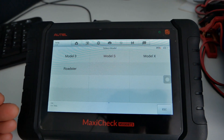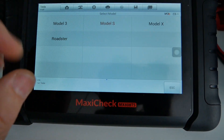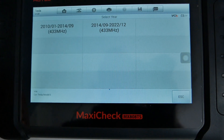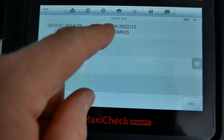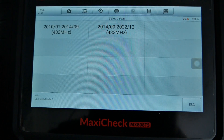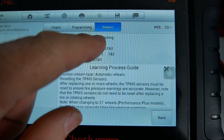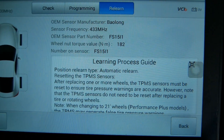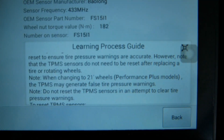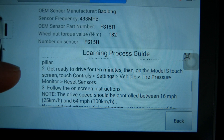In the past you used to have to program the ID numbers into the ECU in the car, but now cars have an automatic learning routine. I've fired up my scanner here and it will tell us what that learning routine is for a particular car. We've got the 2014 models — if I select the earlier 2014 models, which should be the earlier ECU, and go to relearn — there it is, it's got the manufacturer's name. You may want to pause this video and read the text, but this is the relearn routine.